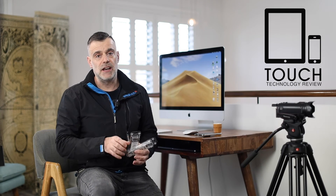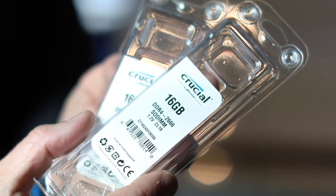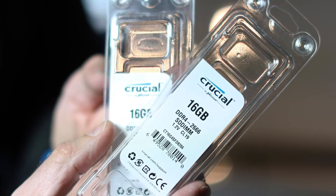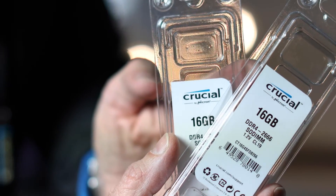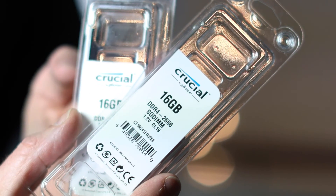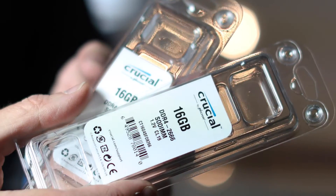Having said that, I decided I didn't really need 40 gigabytes, so I'm taking the two 4s out and just putting the two 16s in. 32 gigabytes in total is more than enough for me. That way I'm running with two Crucial modules, not mixing the RAM in any way, and I'm pretty much assured that I'm getting the best performance out of the machine — so that's how I would go about doing it.